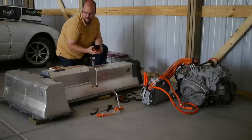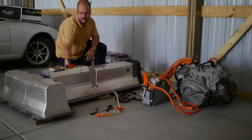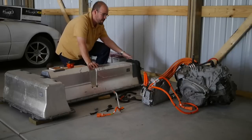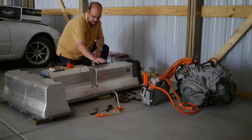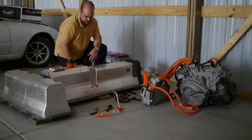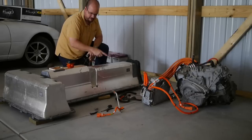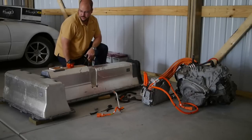A couple of notable features. One is, if you're ever interested, there's a main safety disconnect right there you can pull out to de-energize the entire pack. The connections are made up here between the inverter and the battery, as well as between the charger and the battery. I'll show pictures of that in a bit. As far as the battery, it's actually in a composite case — looks like SMC sheet molded compound, just really fiberglass and plastic. There's a series of bolts going around the side, I believe they're 10-millimeter heads, so probably M8 screws, with two or three dozen going around the perimeter. Taking a look inside the cells is the next step here.